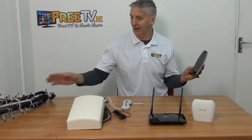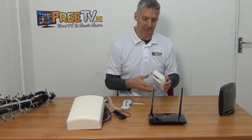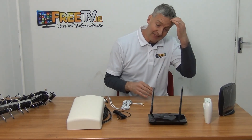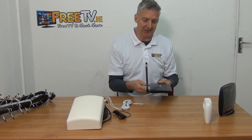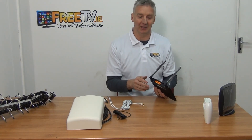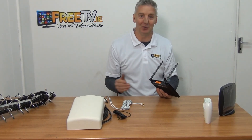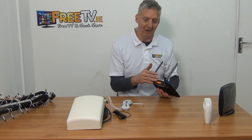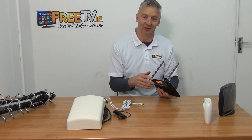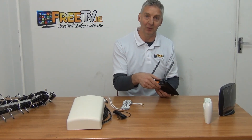This aerial will work directly with the D-Link and the Tenda that we sell. Interestingly, it won't work with one version of the TP-Link, because they made a significant design mistake — the paddles on that version are fixed, so you can't unscrew them to boost the signal. In 95% of situations, people are happy enough with the built-in aerial. But if you bought a TP-Link version 3 or 4 and found the signal insufficient, you don't have the option to change the paddles. TP-Link later changed the design so the paddles are now detachable, and those versions will work directly.